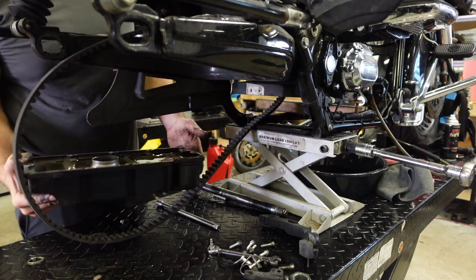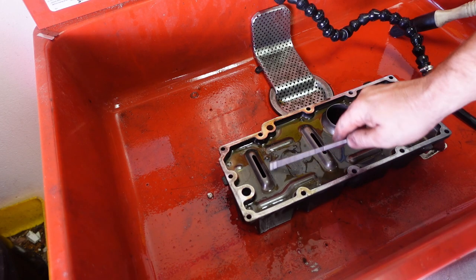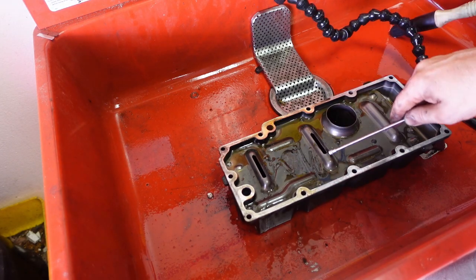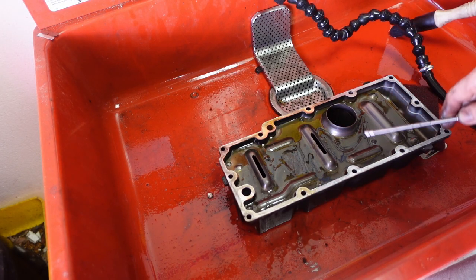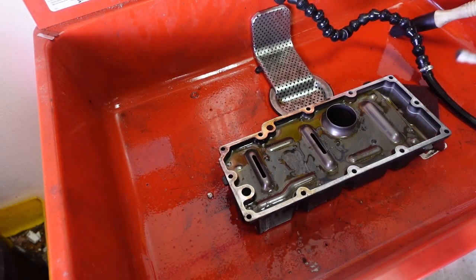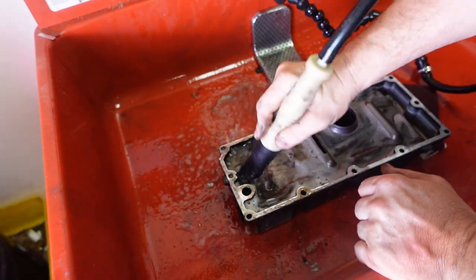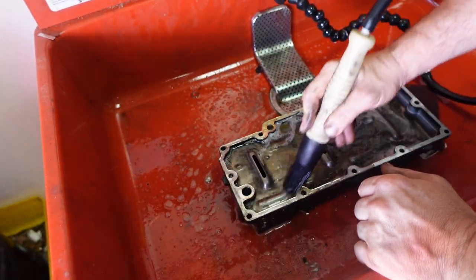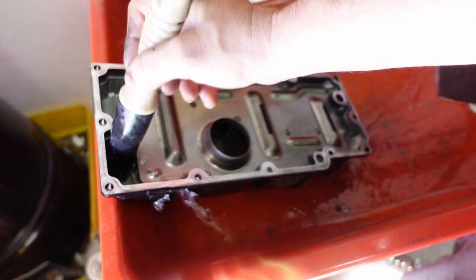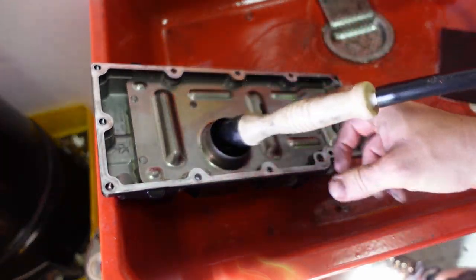It's very important to clean out the oil pan. In this case we had a lifter bore failure — a lifter failure on this bike that damaged the cam and the old lifter. So there's all types of metal stuff in the oil pan that we need to flush out. All that black stuff on that magnet is metal, steel. Here we are flushing it out and rinsing the top off. I'll rinse out the inside as best I can and let my parts washer flush this out for a day or two.